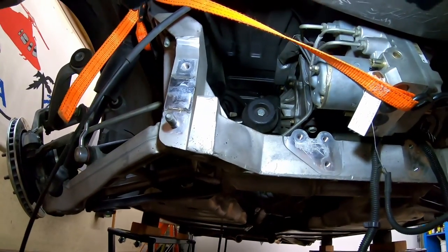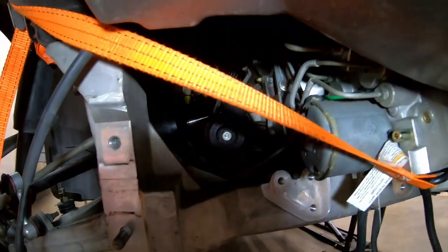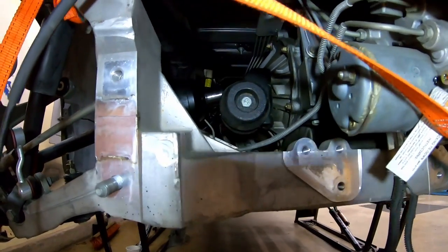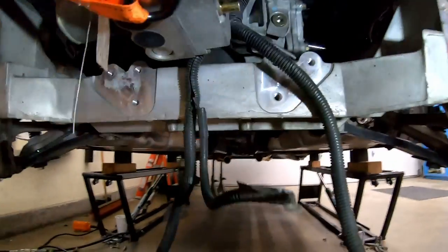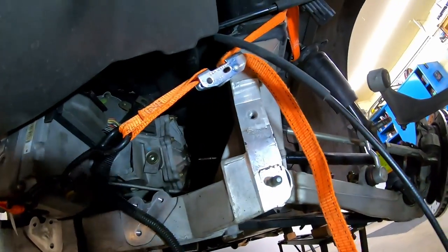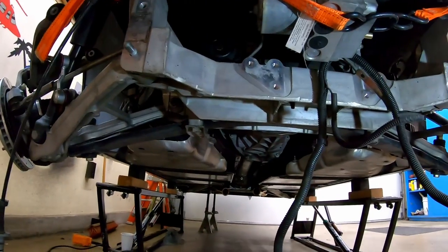I think I'm going to go ahead and take that little dingle ball weight off of the side of the diff. It's kind of hard to see, but there's a brake line going down each side of the diff. That brake line's going to stay behind, and it has to pass in between each axle stub and the differential on each side. Hopefully that shows. Again, I'm going to take that weight off so that brake line will pass through easier. And then we are down to the four nuts holding the cradle to the frame. And it's showtime.